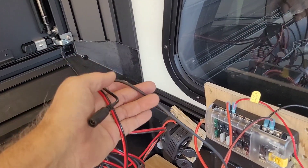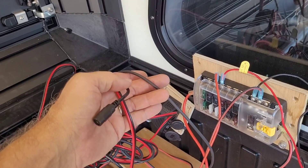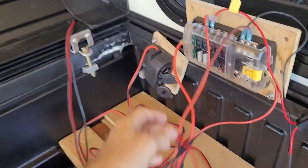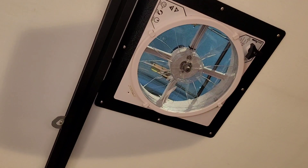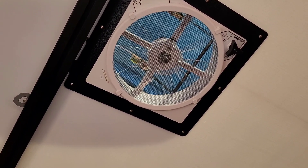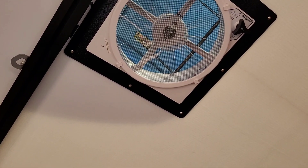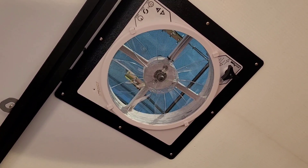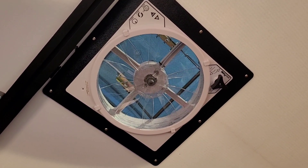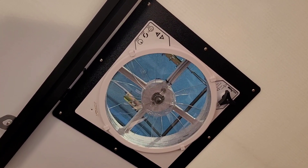The other items that come with the camper: the halo LED lighting is going to be a small draw — maybe 60 to 70 watts, around 5 amps total. The MaxAir fan is probably what most truck camper owners will have. Running on high it only pulls 36 watts, and at setting 10 you get about 2.9 amps.